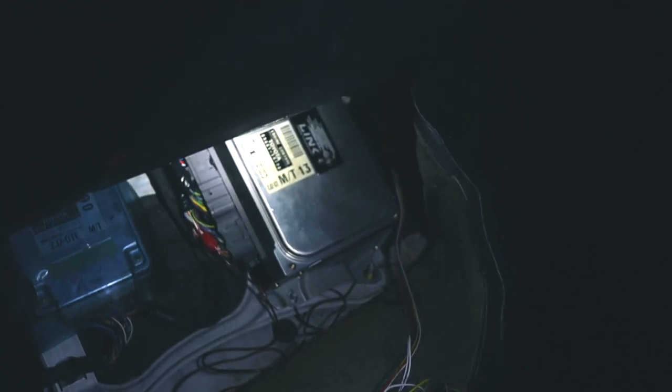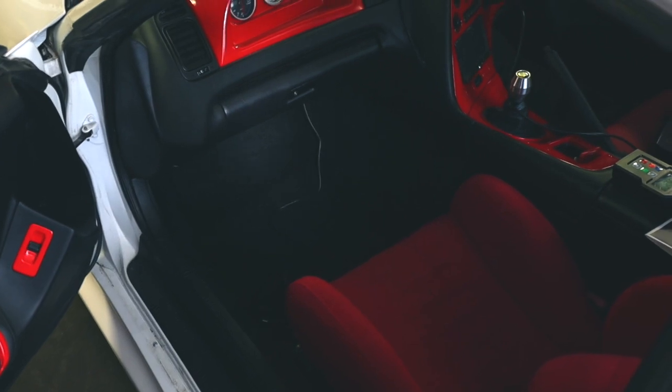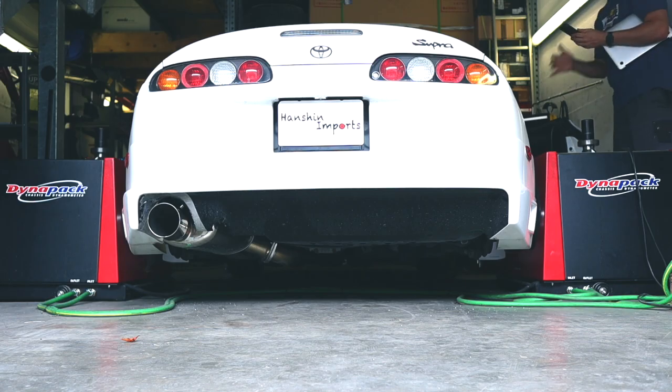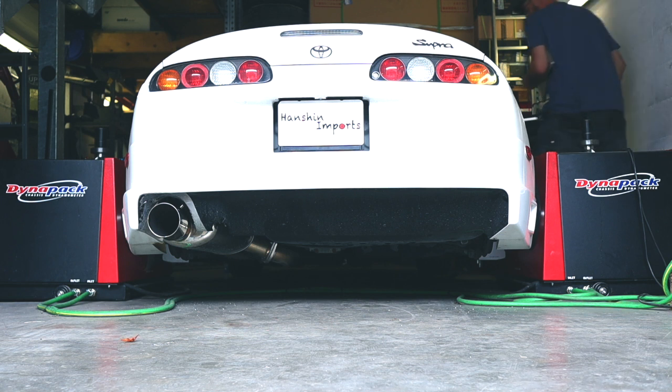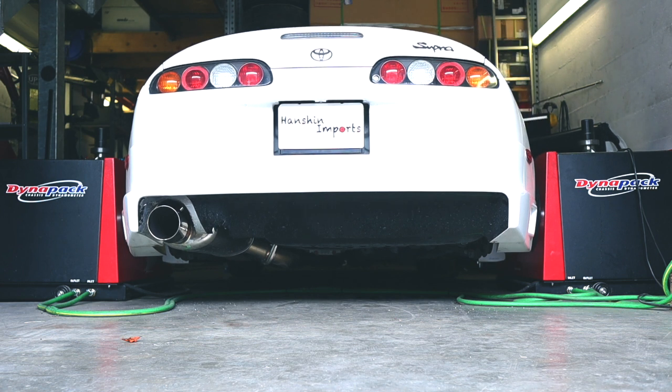It's in its place. I'm going to leave for the moment only one screw fixing it in because we're still doing some testing. So let's start up the ECU and the car and see if everything functions — here you can see where everything is coming out. Now I can hook up my computer, go in, unlock the ECU with its serial number, load a base map onto it that allows me to start the car and activate the closed loop. I also had to modify how the fuel pump is working with the system otherwise the car will not start. Pretty good for a first start.